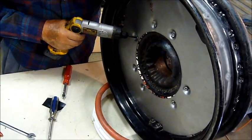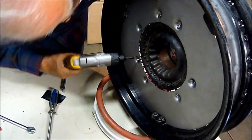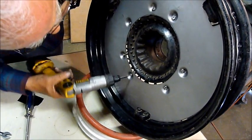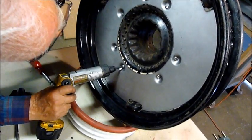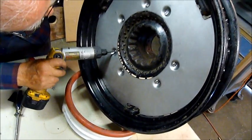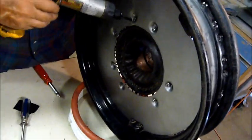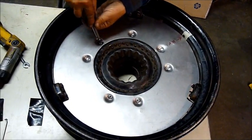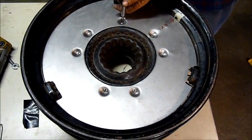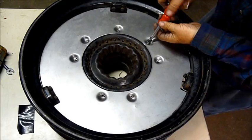Go ahead and power a few of those in. Take your time. It's really difficult to line up on these spoke nipples and they have a tendency to not want to be your friend. Locking screwdrivers certainly make things go faster when properly aligned, but you pretty much have to aim right the same direction the spoke is aimed in order to maintain contact with your screwdriver. In any case, we're going to go all the way around and snug all of these up until the wheel cover is drawn down tight against all the spokes evenly. We're going to cinch up these retainers, and we know that the hub is centered on the other side. Everything appears to be in alignment, so we're using our special piloted screwdriver to give them all even torque all the way around.